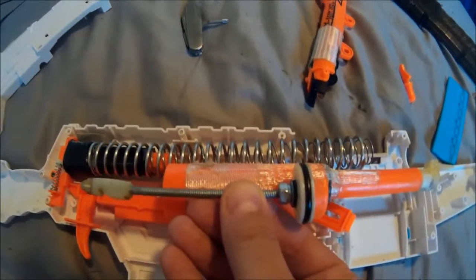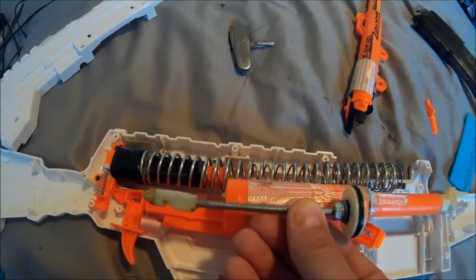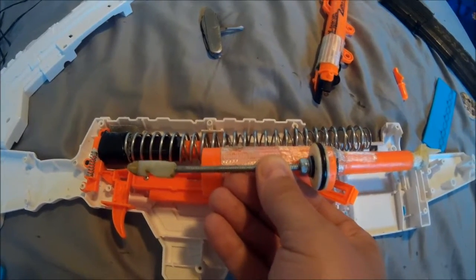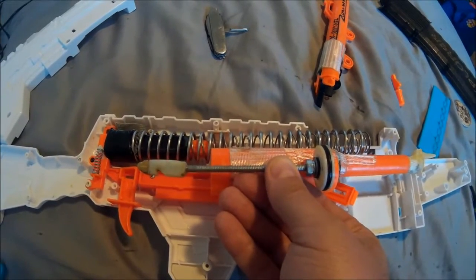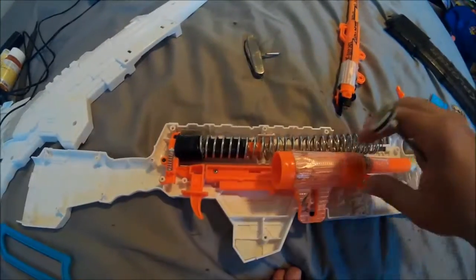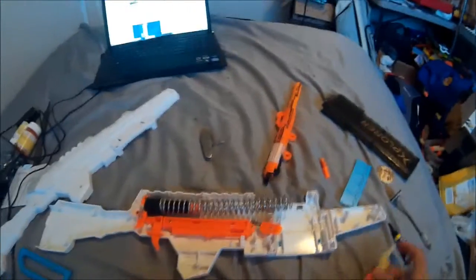That's a Magnus spring and a Century spring. I think it's a Century C810. But if I got the numbers wrong, because the catalog lists it different, it is a 1 inch by 8 inch by 24 coils by .091 spring gauge. That is a really, really heavy duty spring right there. It's about, I would say by itself, about 16 kilograms.